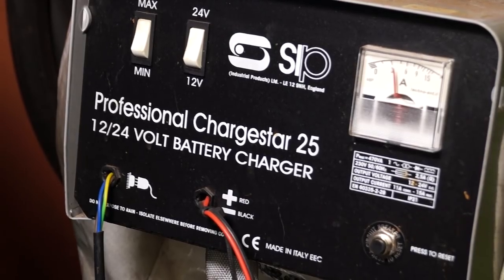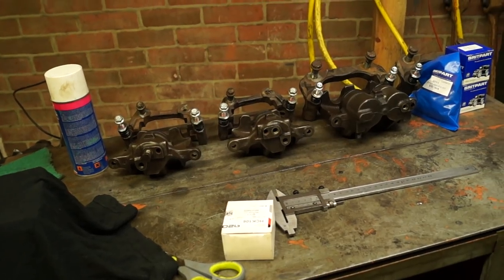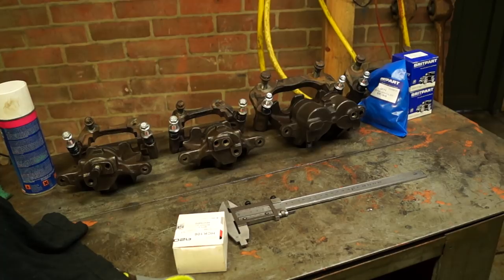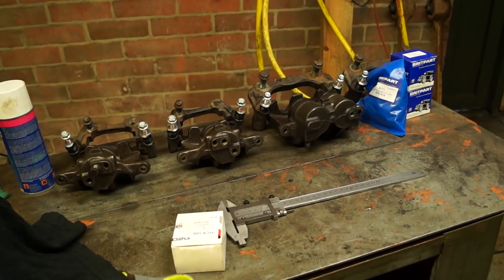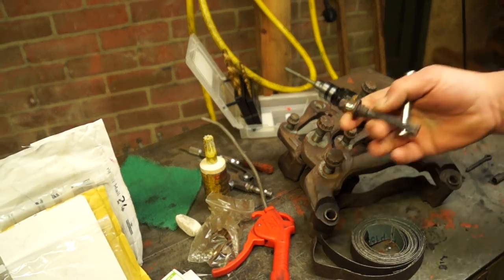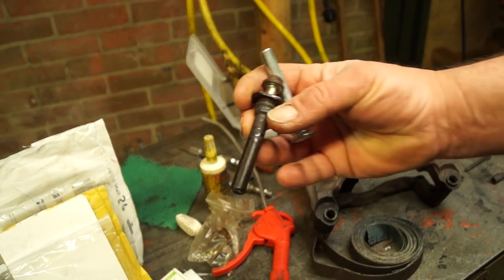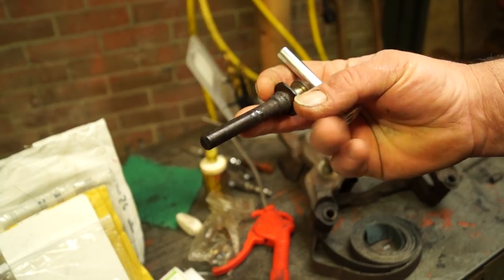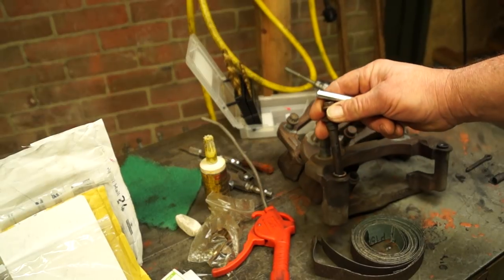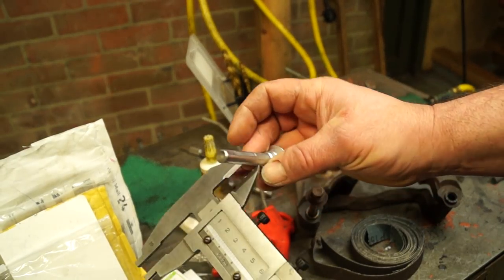This video is not just for when you're overhauling calipers — it's also for when you're changing your pads, because you really need to make sure you have good working pins to ensure your brakes are working properly. You can see what sort of condition they can come out in — not the healthiest — and they want to be freely sliding in the caliper carriers.